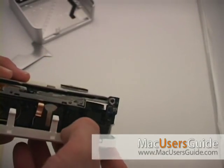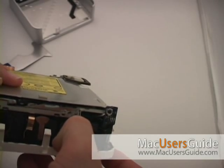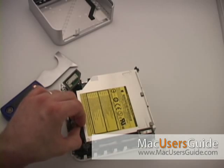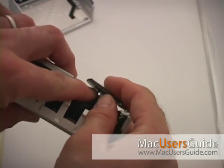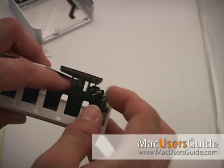Next, you want to re-establish the three connections that you removed: the hard drive sensor, the flexible cable on the audio board — here you want to basically just stick the pins back in and slide the connector back down — and finally the AirPort antenna. Here you'll just have to pinch and push down and it'll snap into place.